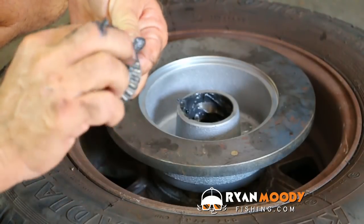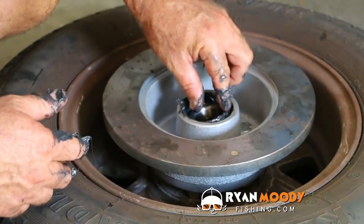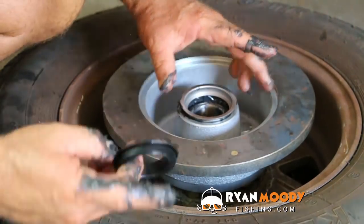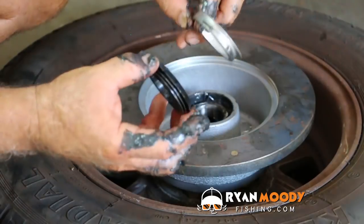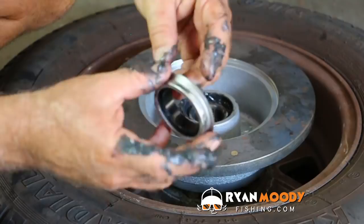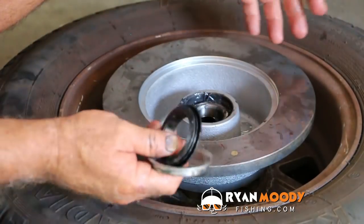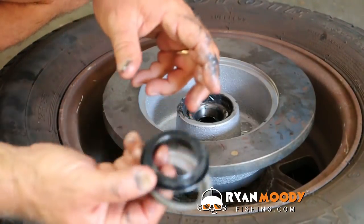Okay, nicely massaged in so it's gone right through all the rollers. Now we're going to slot him in and sit him inside that insert. There we go, nice and square. Then simply put the marine seals on the back, tap that in. That goes on the end of your axle and make sure that squeezes in to the back of that, sealed right in there nicely when it's on the back of your hub. Just give it a nice smear of grease in there too. Waterproof grease is the best for that. And of course you do the front bearing on the other side as well, same way, except you haven't got those seals there on the back.